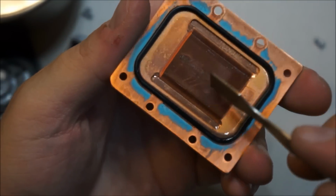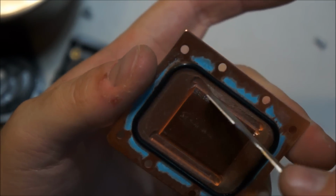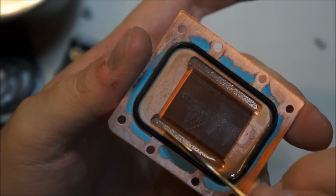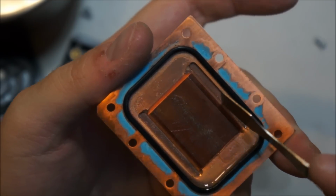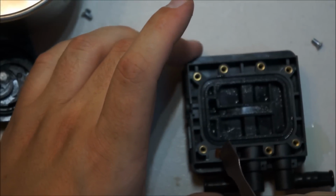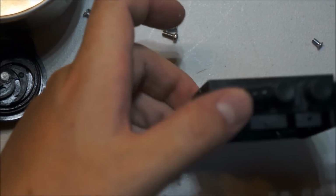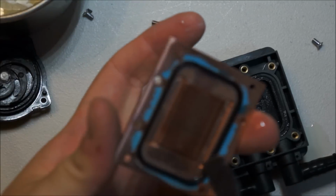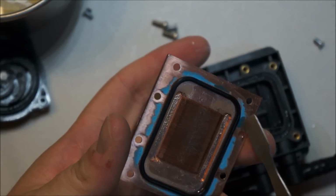So anyways, you can see that it looks like they used just a straight up 1/8 inch end mill to machine these two trenches here, which are largely for the fluid outflow. And then this is basically, yeah, you can actually see here's the thermistor that pokes through. So what happens is that it just winds up being in physical contact with one side of this.